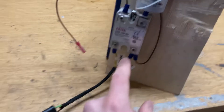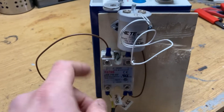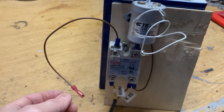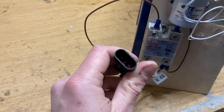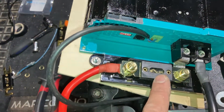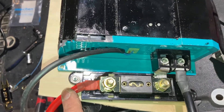We also have this solid-state relay — it's pretty big, 100 amps peak. This is just to control the activation of the DCDC, and eventually I can also control all the other loads in the future if I need to switch on loads only when the engine is running. Essentially, this will go to my switch and from the switch to the DCDC. This Amphenol connector here is supposed to connect to the connector where the run, ground, and K15 signals come out. There is also a 60 amp output fuse on the output of the DCDC — a bus bar, fuse, and then the cable charging the lithium ion battery pack.